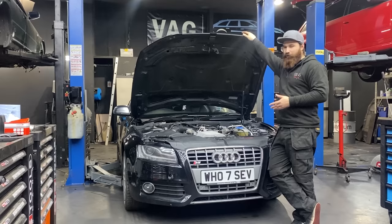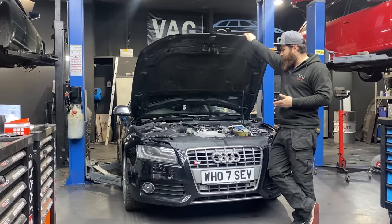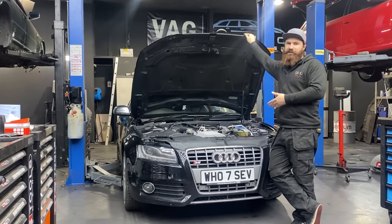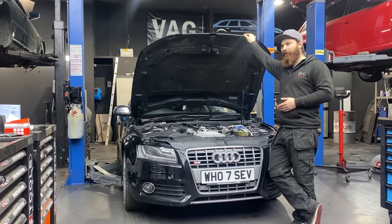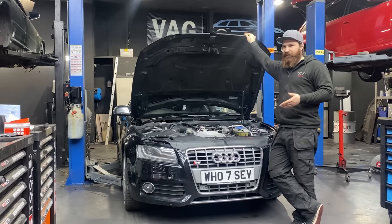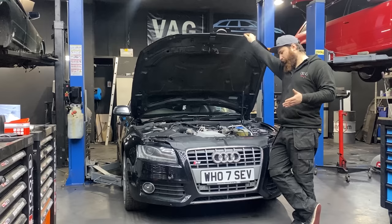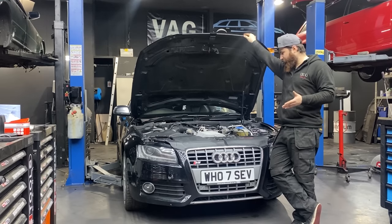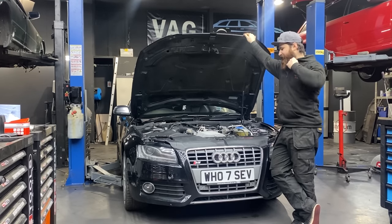Two on the inlet and two on the exhaust. And we also have four solenoids which are controlling them. We found out one of the solenoids was faulty. It didn't come with any fault on the exact solenoid, but after we replaced it, the car was running well. There's no multiple misfire and all the numbers start moving again. So from that point, the car was pretty much fixed the first day since it was dropped,